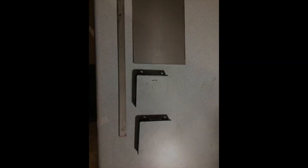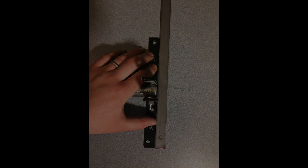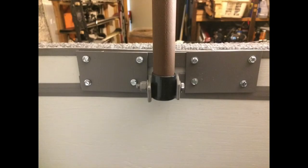To attach the roof to the camper and act as a roof lifting mechanism, I went with a three-quarter inch EMT system I found from another user on wanderthewest.com. I already have a couple of videos about that lifter. Briefly, I'm using three-quarter inch EMT aluminum from the local big box store, making sure the pivot between the two pieces is exactly in the middle — if not it won't close correctly. There's some jerry-rigged mounting systems for both the top and bottom. Go check my other video for all the discussion about that.